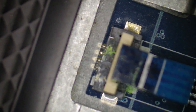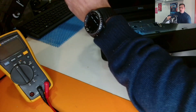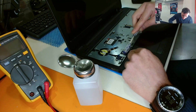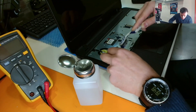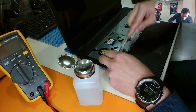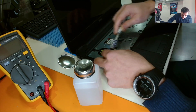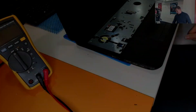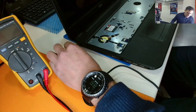This is the ribbon cable of the power button and probably this is the cause. Before I proceed to the disassembly of the laptop, I will try to clean this first with some IPA and then we will proceed again. We wrap it with a toothbrush which is soft and does not scratch the board or the connector. It removes the corrosion and all the dirt from it. Let's try to power up if we magically fix the problem.